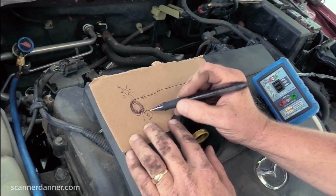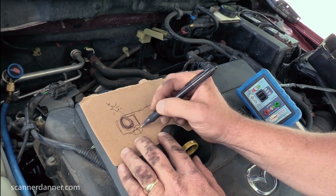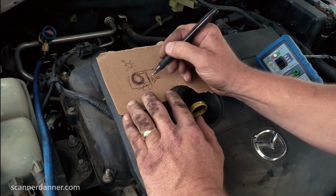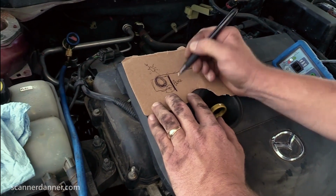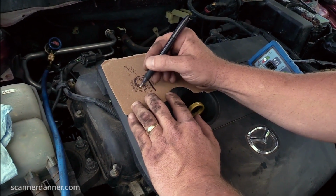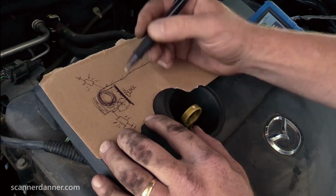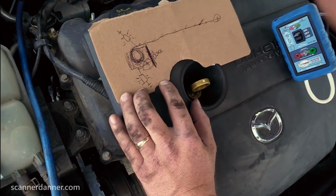Okay, just to reiterate that, where's this ground? It's on the housing of the compressor, okay? And what does the housing of the compressor ground to? It grounds to the block. So realistically, we could have a mounting point problem between the housing and the block. So we're sending voltage in, it goes through the coil, goes into the ground, and fills the housing with 12 volts because there's no ground to the block. So when you touch your test light on there to ground, it would light, telling you have a bad block connection ground problem. Not our issue at all. All right.